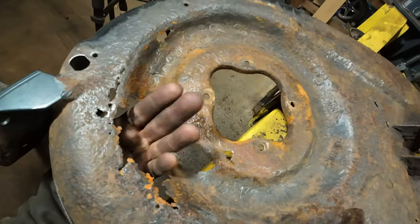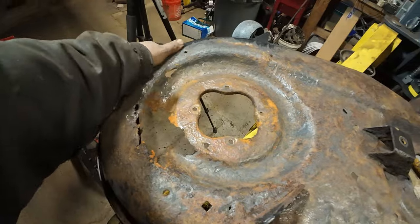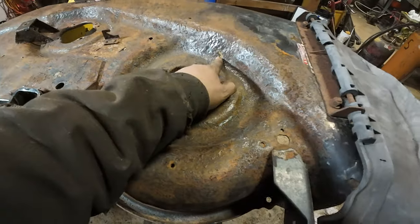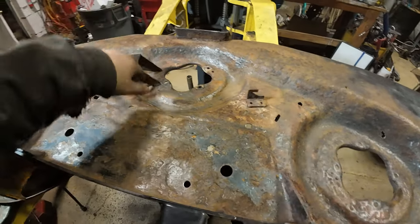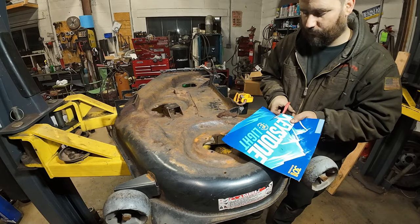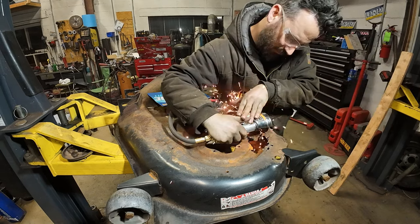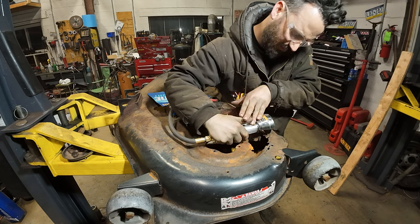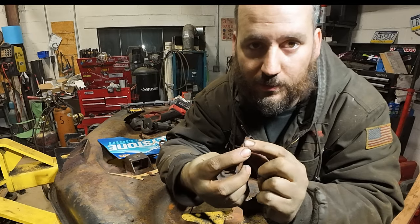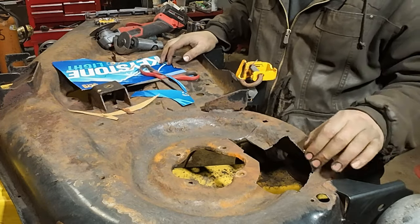Here's our problem area — it's a pretty good-sized hole, but we needle scaled and brushed everything, so all the flaky rust is gone. We're down to whatever's left, which ain't much. Had a couple pinholes develop here, got a hole here, hole here, hole here, and a hole here. Take care of those. Center section looks good, nothing to do there. Let's get templating. There is still some good steel here — you can see where I cut it's full thickness, but on the flip side it's totally a knife edge. I had to cut out a lot more than I'd like, but I have to get back to solid steel so I can weld this all back together correctly.